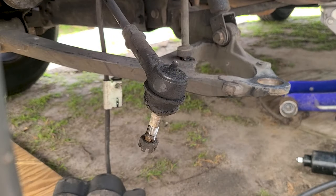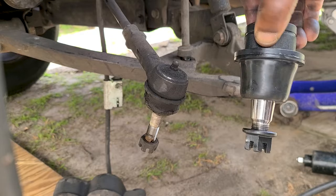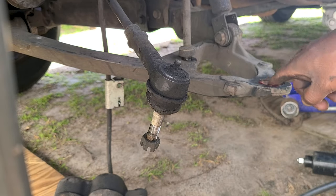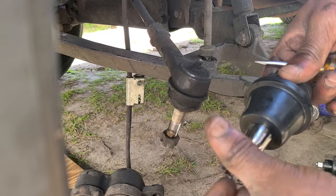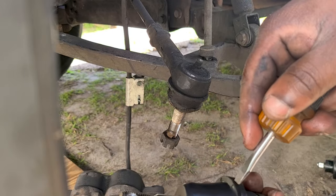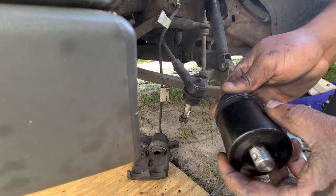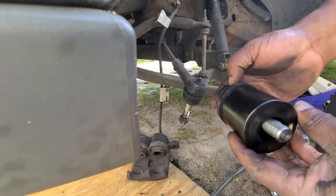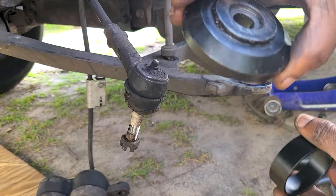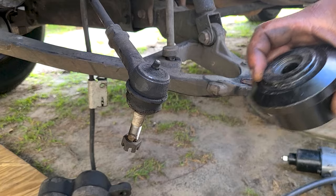Check out the new ball joint. You got to lube that boy out, make it easy to go in. Now on your new ball joint, I'm going to go ahead and remove this new nut, and we're going to go ahead and remove this boot right here. I'm going to leave the boot on this time — I'm going to find me a ring that's going to slip right over it, to be able to press right up on it. That boot was just so hard to come off. Then I'm going to take these two pieces, and there is going to be my top, just like this.